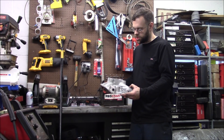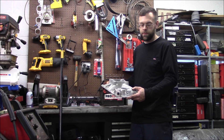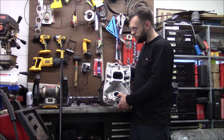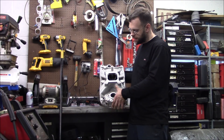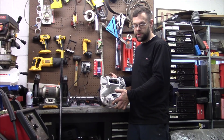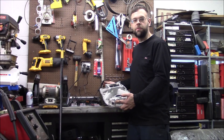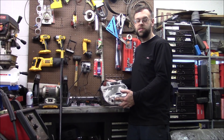I'm not sure the exact vintage of the Torker — I would assume it's 70s. But I just have to repair the threads that are damaged in the thermostat housing and the carburetor flange, which is common for these older aluminum intakes. Normally over the years the threads just get galled or ruined. So I'm going to show you how to repair that today using some Helicoil kits.